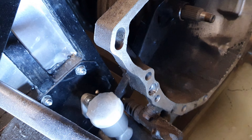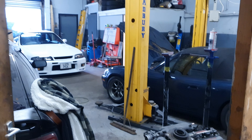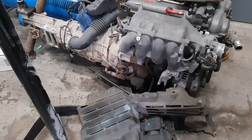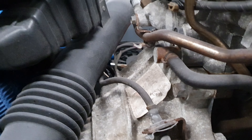Well, it's completely pointless. Having put this gearbox on and squared it at 90 degrees - making sure the gearbox is perfectly parallel - it's still going to hit. Which is pretty annoying to say the least, but as you can see it is just where the edge of the pedal box assembly is going to be. You can actually see the reflection shining back on it. The issue I've got here is I am pretty much out of room. Even if I trim the pedal box back, it's going to hit the chassis. If the pin's going to hit the chassis, there's a pretty good chance the arm will as well. But the problem with the arm is I don't know how much full travel I'm going to need, because I don't have a clutch to activate on so I can engage and disengage it. And the only way to do that is to throw the engine in for this one thing to suss out. So I need to come up with some other way.